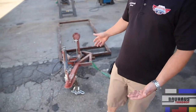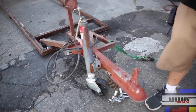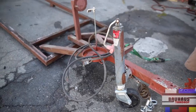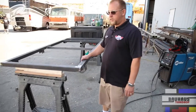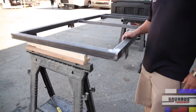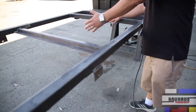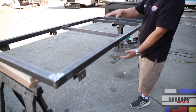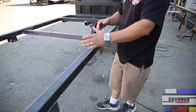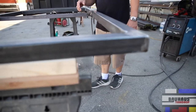First thing we had to do is start with a good chassis, because when it came in you could see it's crooked — it's not gonna tow very well, it's gonna lean to one side. There's the axle and the leaf spring. Over here, we have a much stronger, much better built chassis with new hangers. We're going to install the spare tire under here. We're going to flip the axle so the customer can get more ground clearance, because on the old box you could tell where the axle had bottomed out.